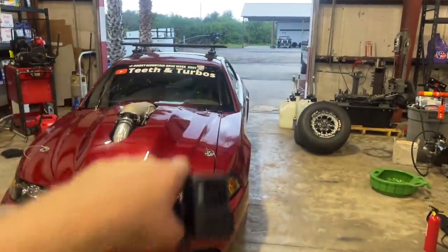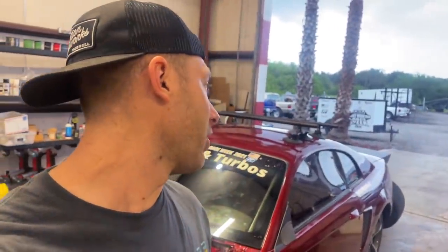Ready to go on the wedge — she's ready, people. I decided it'd be better to fix the oil leak before we left. Luckily it just ended up being the oil pressure sensor. I unscrewed it and the O-ring ended up being too small, so we loaded it up with some RTV and got her back together. Car's not leaking oil anymore. I need to let the RTV set for a bit. If you guys like today's episode, there's going to be a ton of content coming out next week — every day I'm going to be posting a video. Race Week 2.0, leaving Oklahoma City and traveling through Kansas and Texas.